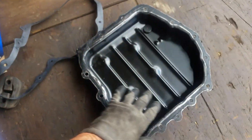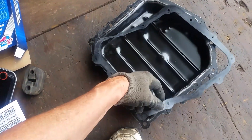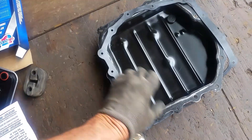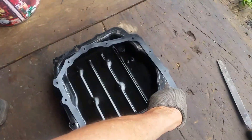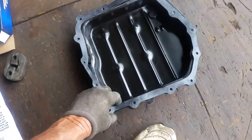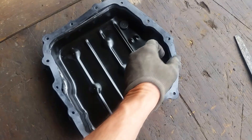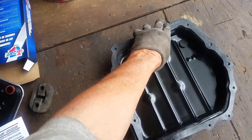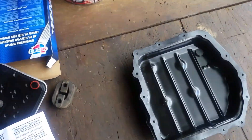I'm going to use this gasket — I kind of like the old cork gaskets. On a warm day just let it sit for a little bit, or go ahead and start a bolt on each corner with your fingers as you're putting it on the transmission. Take your time and don't over-torque these bolts because it will squeeze the gasket down and you'll have a leak eventually. I think it's only about 14 pounds — very little torque. You might want to look up your own torque specs because different transmissions on these Chryslers are a little bit different.